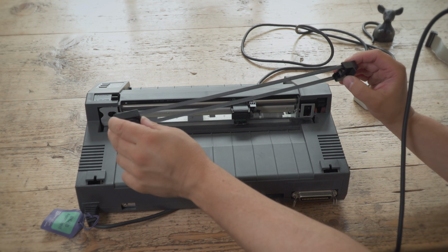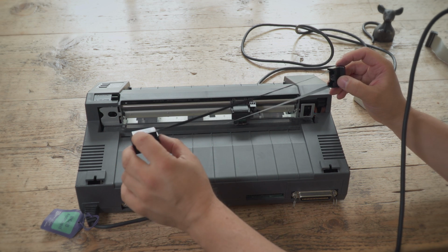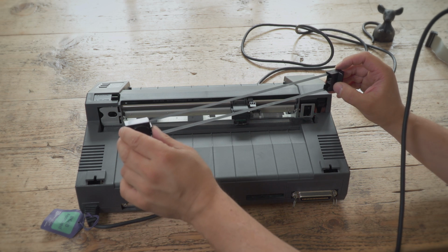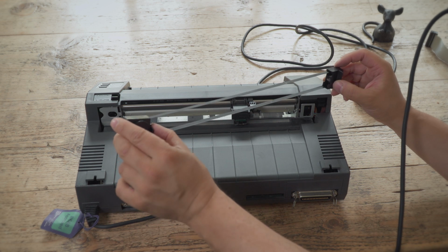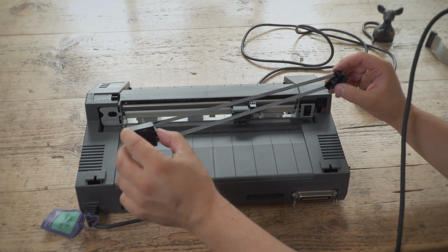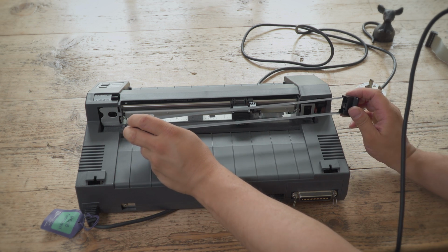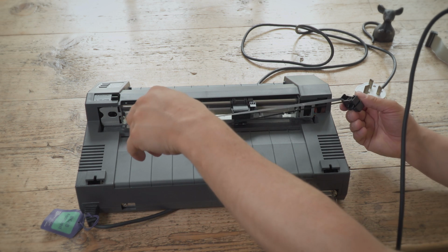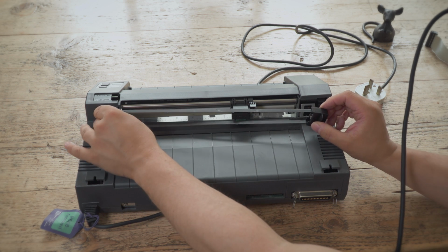There's the ribbon you see there, that's all there is. There's no spool of ribbon inside these little cartridges. They're just sprung, and it just travels round and round. It's not like a Star printer ribbon where there's loads and loads of ribbon in there. So these things used to run out really quickly. Again, people might say, oh, that's typical Amstrad, they'd want you to use lots of consumables. But this was just how Reitman did it. As I say, this is an off-the-shelf design.